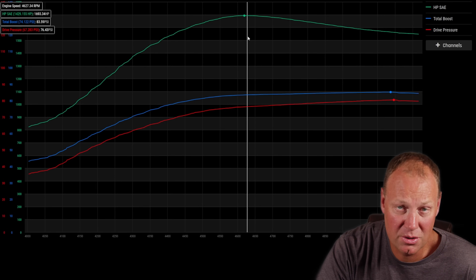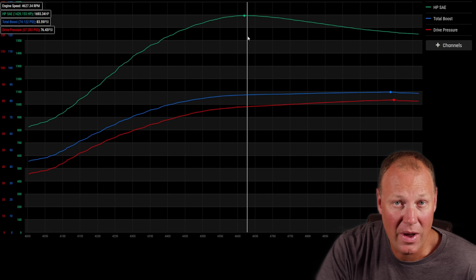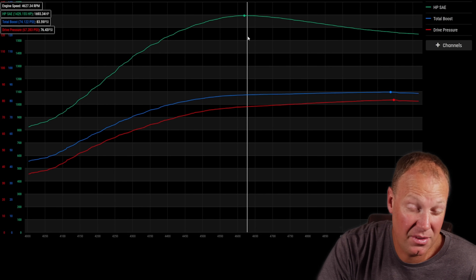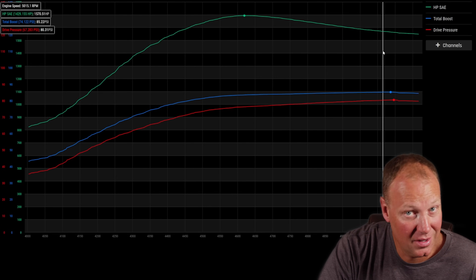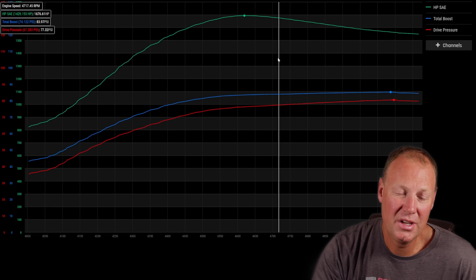It's carrying pretty well. If this turbo was small and boost was lower while drive was high, the power would just nose-dive — dropping like a rock. As soon as drive overcomes boost in a turbo, power just falls. On this setup it's a little bit too much wastegate but mostly I'm just making sure it's opening because I have plenty of drive with the nitrous to run the turbo. A wide-open 50 millimeter wastegate is doing its job. I'm thinking about adding more nitrous, in which case I'll need two gates.